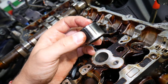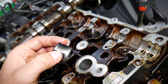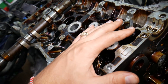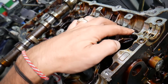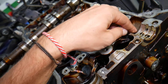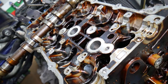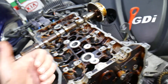Now, if you have a valve lifter noise, often it's because someone worked on the engine — say the cylinder head was removed for a head gasket replacement. They'll remove the cylinder head, put it upside down, the valve lifters will fall out, and they won't know where to reinstall them. So always mark them: which position is intake, numbering one through eight, and the same for exhaust. That way, if they come out, you'll know exactly where they go. That's usually what causes valve lifter noise. Hopefully the video was helpful — thank you for watching, and see you guys next time.